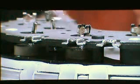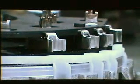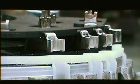What we're going to do is remove the old-style rectifier. These silver things are the stator leads where the leads come up and solder into the rectifier. We're going to replace it with a rectifier that has drop-down leads — an aftermarket design for ease of installation. Get yourself a pair of side cutters, turn them upside down, and cut as close to the rectifier as you can so the wires are as long as possible. There are six of them that need to be cut.